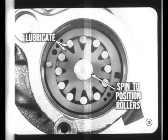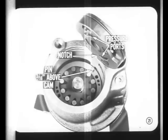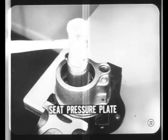If the rollers were cocked, they would interfere with the assembly of the pressure plate. Before you install the pressure plate, make sure the end of the dowel pin is 3/16 of an inch above the cam plate. Line up the index notch with the dowel pin. As a final check, look through the pressure ports. You must be able to see all 6 holes in the cam ring, 3 through each port opening. Be sure and seat the pressure plate against the cam ring.